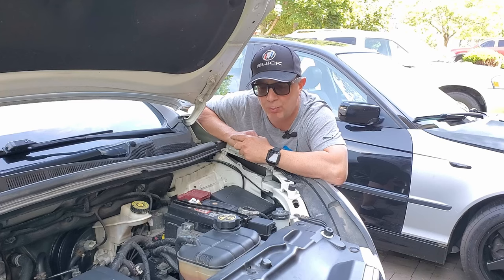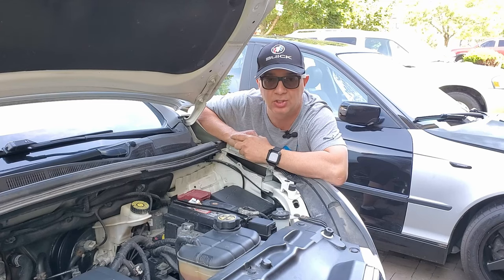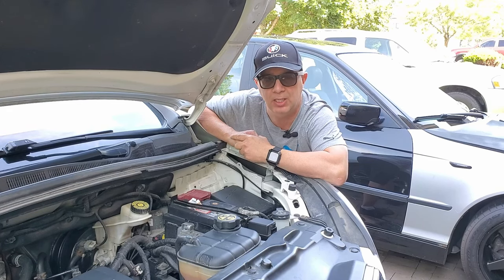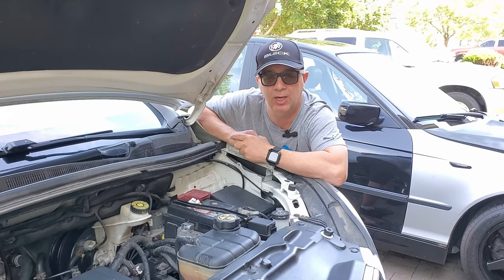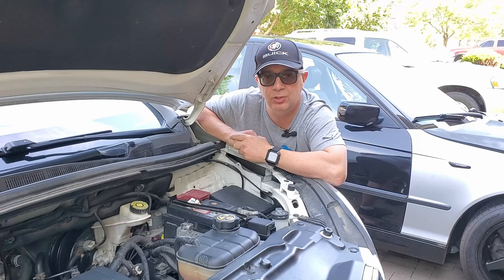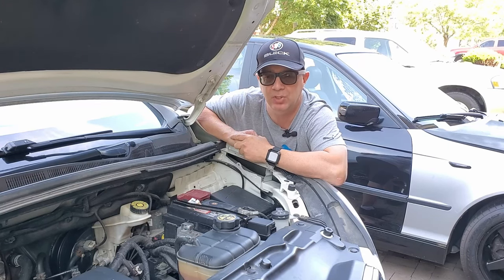What I'm doing is opening up the bolt in the bottom of the transmission, just letting it drain freely, which takes out about three to four liters of fluid. Then I measure it exactly and refill the transmission with the exact amount, driving it to dilute the remaining old fluid, and then doing it again. This third time will percentage-wise allow me to dilute the old fluid to a point where it really doesn't matter much. I'm sharing this as a plan B in case you run into this issue yourself.